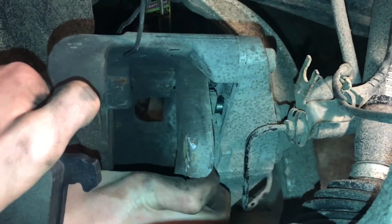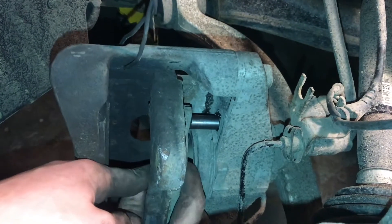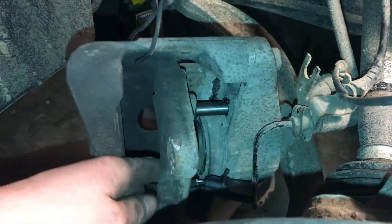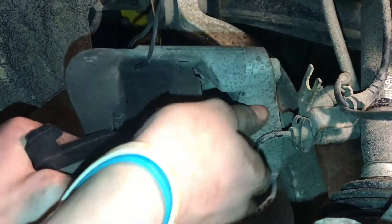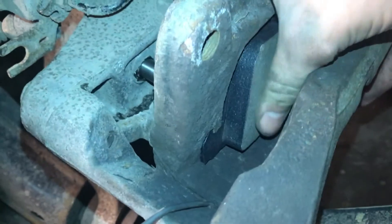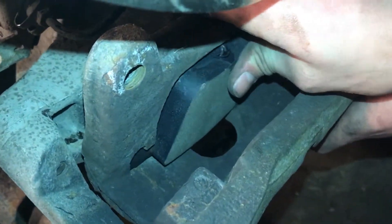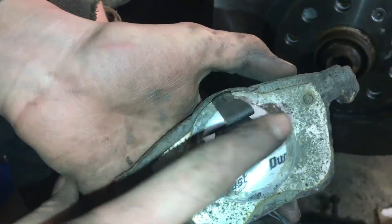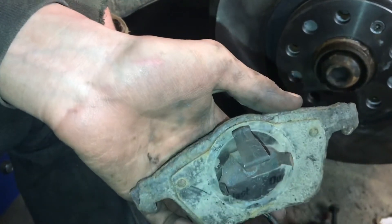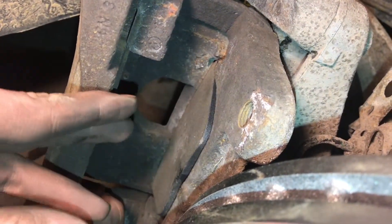Whenever you're putting the new brake pads in, don't just muscle them in — that's something you definitely don't want to do. If the guides and little tabs don't fit, make sure you take a grinder or a file so they do, because if they don't glide smoothly that could be a big problem. These actually fit in really nice — they go right in and they're smooth, just how they're supposed to fit. It can be a good idea to put grease on the springs; they go back into the cylinder, so just keep pushing until you feel all the springs snap in.